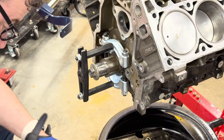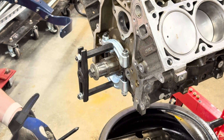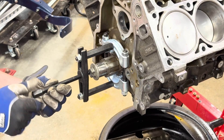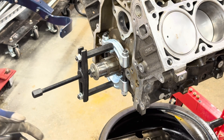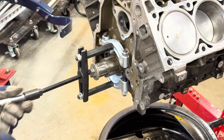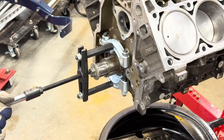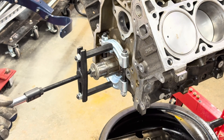I'm doing this live. The original crank bolt is in here — I'm not using the new one, though a hardened replacement did come with my kit. It does have a point on it, it should be okay. I'm not using an impact — I just want to go slow and steady just in case I get teeth breaking. It does feel like it's moving — yay!